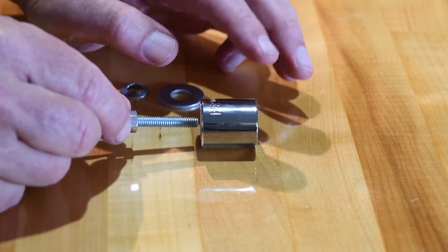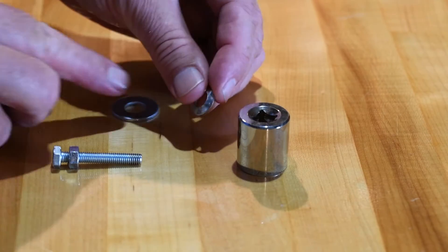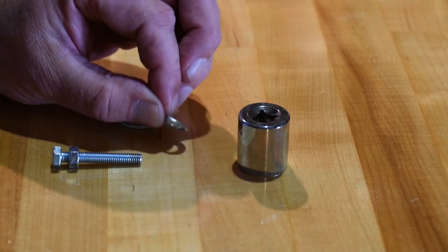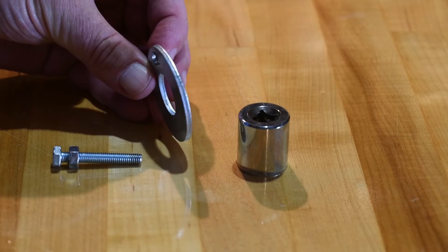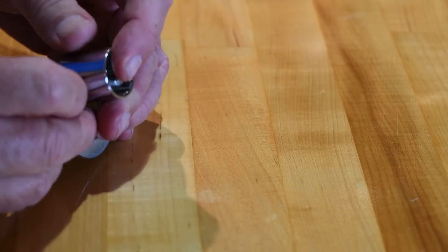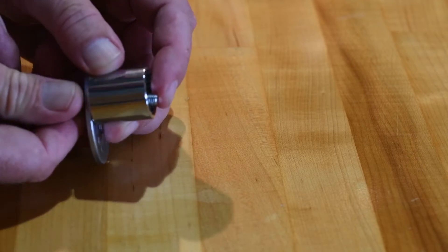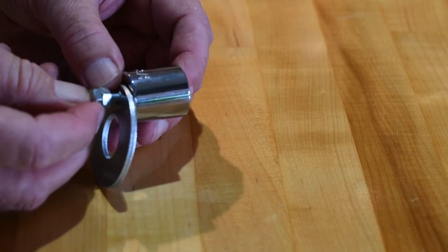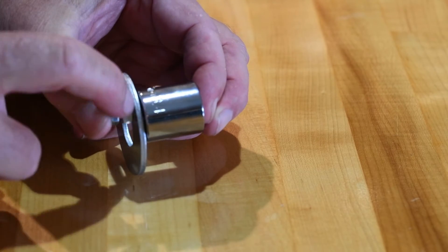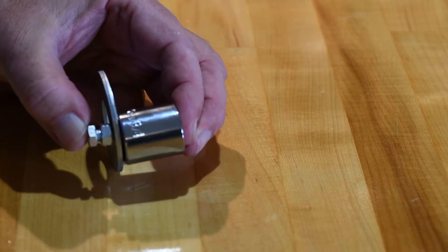What I needed to do was somehow keep this thing from falling inward. I first tried using a small washer and a big washer together, but they tended to bend and weren't strong enough. So finally I took a very thick, heavy-duty washer, drilled a hole of the correct size in the edge of it, put the bolt through that, and now I've got a bolt that can engage the pivot nut right here. After it's engaged, you turn down the middle nut inward and it gradually pulls the nut out. You stabilize the outer bolt with a wrench, tighten the inner nut down, and it basically pulls the pivot nut right out.